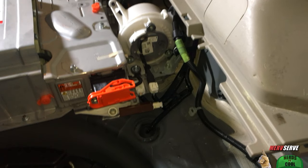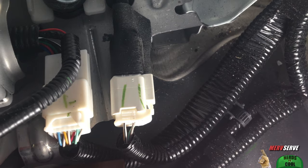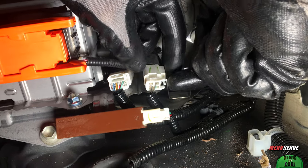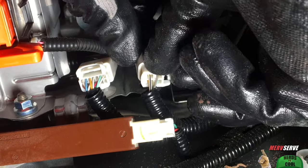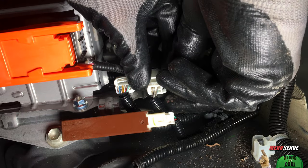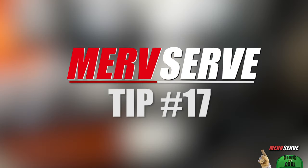Let's focus on this area — this is the fan, with all sorts of multi-pin connectors which aren't that easy to take apart. It's a little bit of a pickle. If I pry out these two push fasteners I'm going to give myself a little slack so it's freer to come out. Then without forcing anything, you just want to go nice and easy — don't ever muscle it. These are fragile. Just get a good grip and push in on that side ever so gently, and it's just going to come sliding right apart.